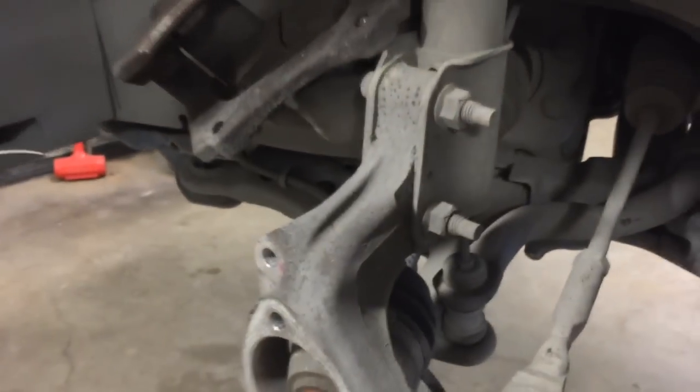In this case, a little over a year ago the left front hub assembly was replaced at the dealer with a quality part. However, there's some type of defect in there. The sensor is part of the hub assembly itself and it's going to require a complete hub assembly replacement. I'm using the National hub assembly, which is a quality replacement part, and I have 100% confidence that that's going to get this thing wrapped up and back on the road.